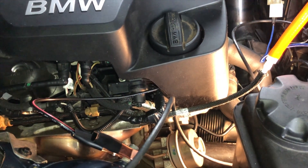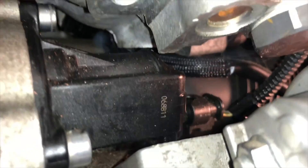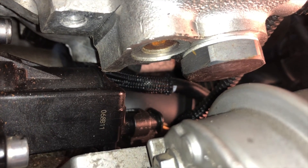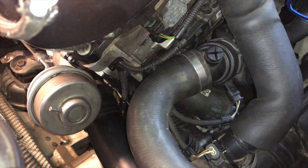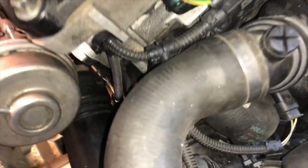Now that it's been a few minutes and the system is fully filled with smoke, we can see where the big issue is on this car. If I go deep inside, this is our turbo right here. There's a decent amount of smoke coming out of there, and this would definitely cause the kind of issues I was having. As I was troubleshooting, I moved this big intake that goes to the turbo — let me do that right now.